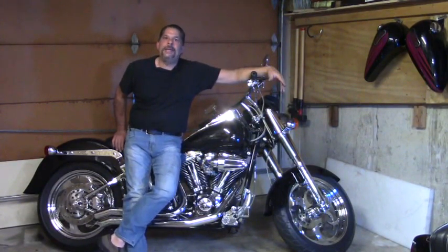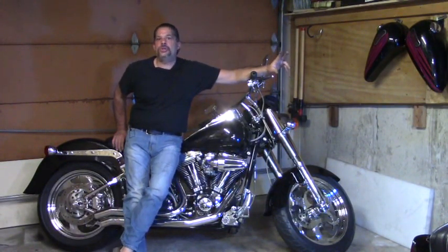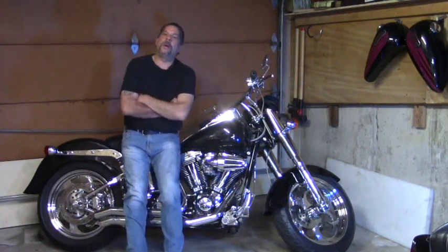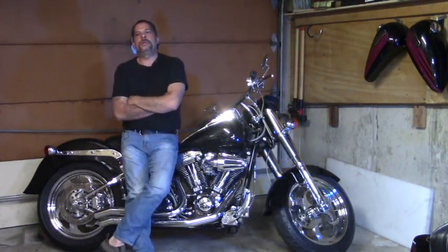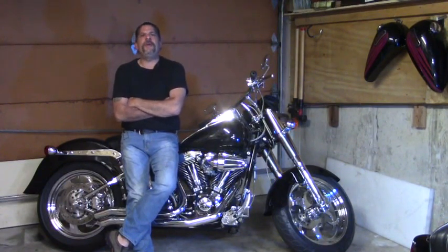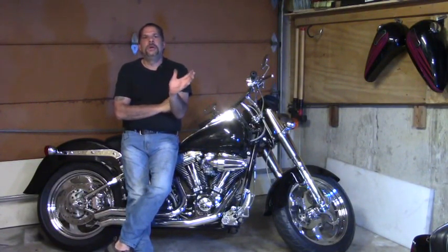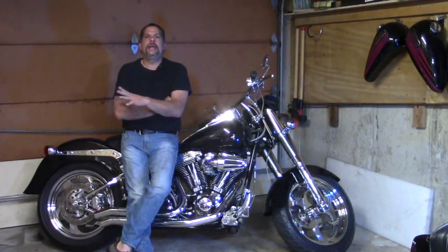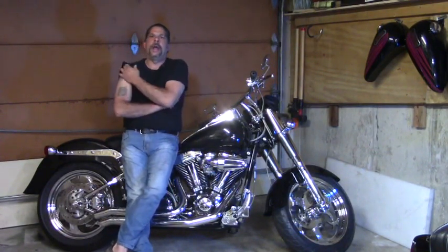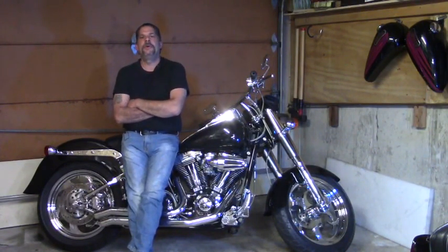I'd highly recommend doing a little research. There are at least 2 great electrical companies out there. Do a little research on the internet. I believe they make a 42 amp 3-phase system. Go 3-phase, and you'll find that volt gauge will jump up when you start the bike and stay up while the bike is running. Again, those volt gauges are typically a volt or 2 off.